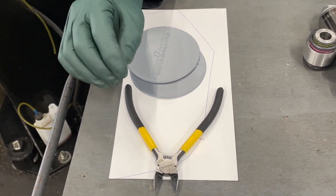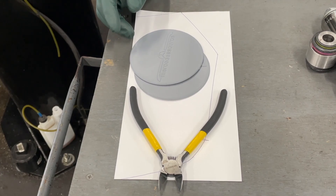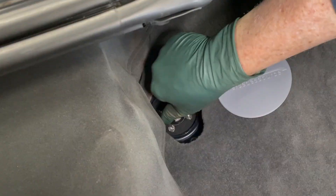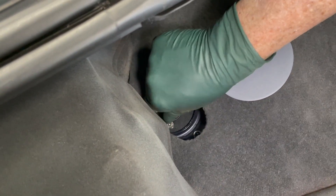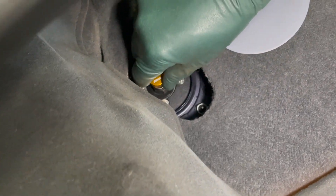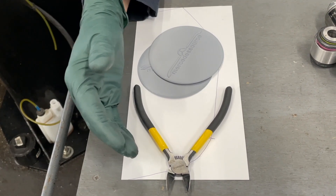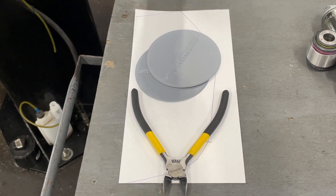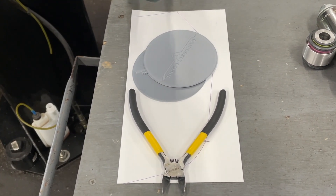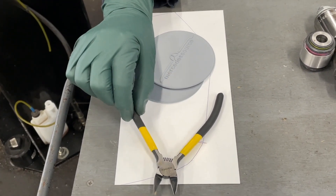I've also come up with three kits that you might find very helpful if you're doing an ABC conversion yourself. If you watched my series on the ABC suspension, you know I am not a fan of trying to remove all the carpets from the trunk to get to the top of those rear struts — that's absolutely ridiculous. So I learned how to cut a hole in the correct location, then came up with covers to cover over the hole, because if you install adjustable coilovers you're going to have to have holes in your carpet anyway. This allows you to remove the struts and install the coilovers with ease.